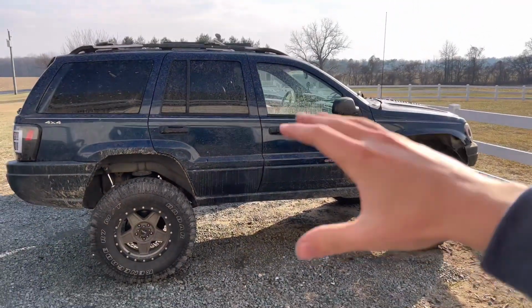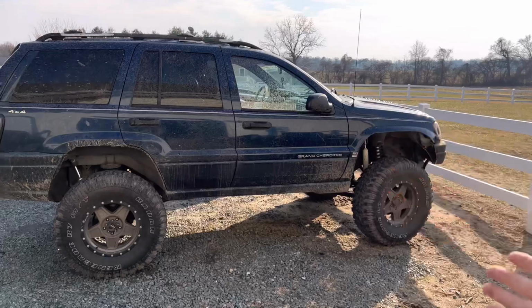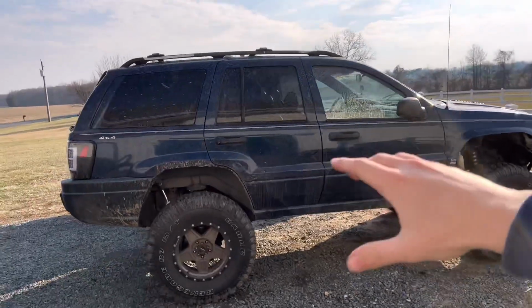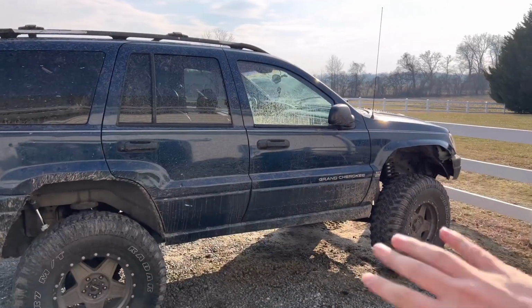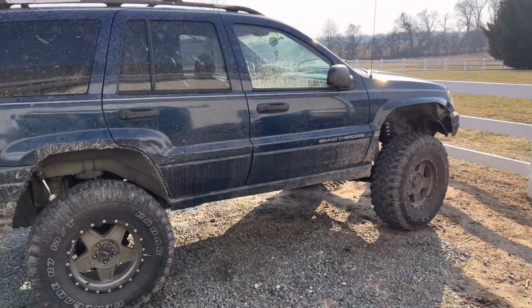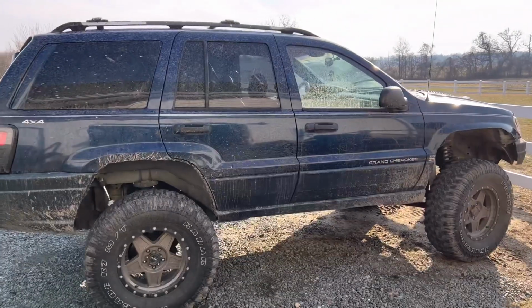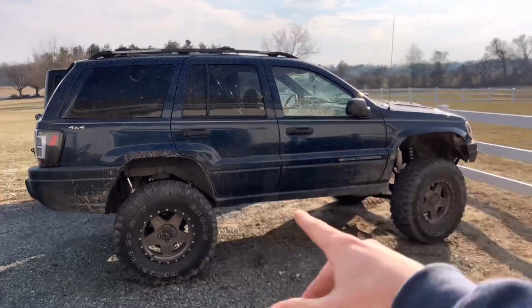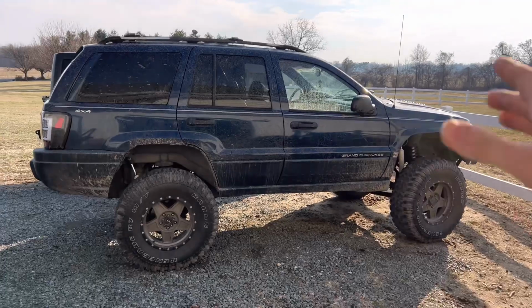So I'm definitely going to have to order some new ones because we're not going to be on 1-ton super quick, just because it's super expensive and time consuming. So I'm going to call up the guys at Adams once I get everything set up, finalized, such as control arm lengths and all that stuff. I still have to go over all that again, make sure it's all still good, and tighten everything down one last time, and then we'll order some new drive shafts for this thing, get those put in.